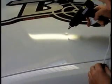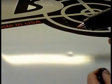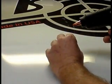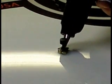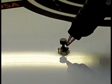Apply the glue directly into the hole. Sometimes if I'm having a hard time getting it to adhere to the panel, I'll take some 2,000-grit sandpaper and scuff it up a little bit — don't go too deep. I'm not going to do that in this demonstration. I'm going to glue it on and then apply more glue around the tab. This is the proper way to glue — glue around the tab with quite a bit, enough so it's going to hold.